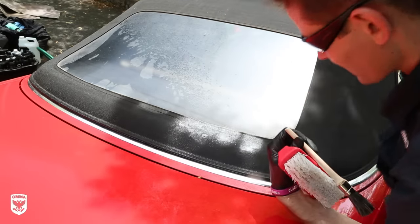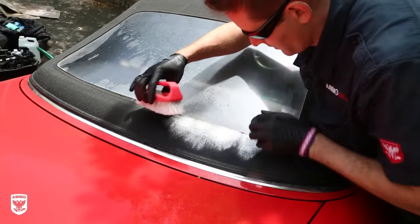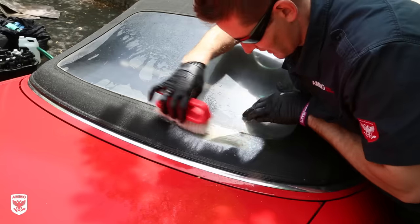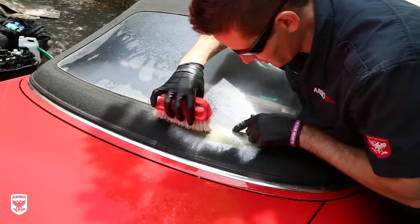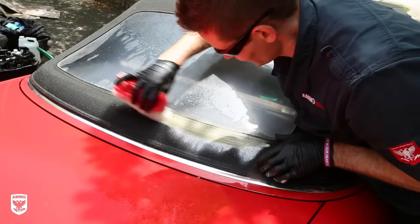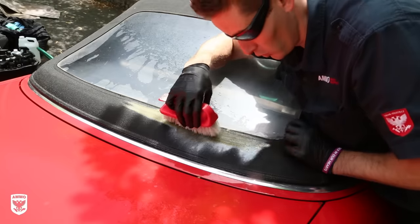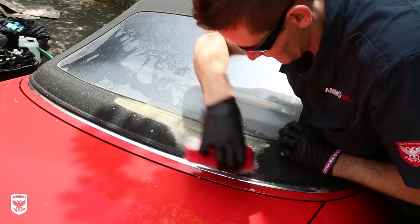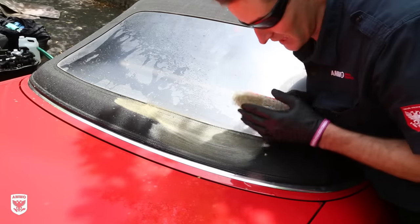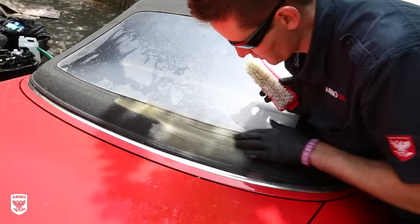Now I need you to be careful with this part. Right on the seam, I want you to take a stiff bristle brush. Make sure you don't hit the plastic piece — meaning the glass or the vinyl window here. You're going to rub just a tiny bit. Look at that — you see the coloration that came out — because it's super stiff. I don't like to do this, and you're not going to want to do this every single time. This is an extreme example of really bad mold. I'm just going to lightly go in there. Notice with my brush I'm not going in circles — sometimes the fibers can get funky, especially on an older top — so I'm just going to do straight lines. Use it sparingly; you don't want to artificially scratch the vinyl window either.